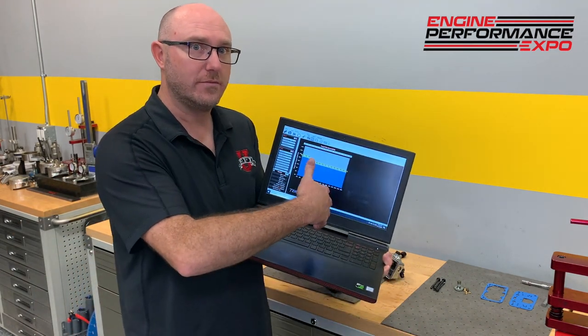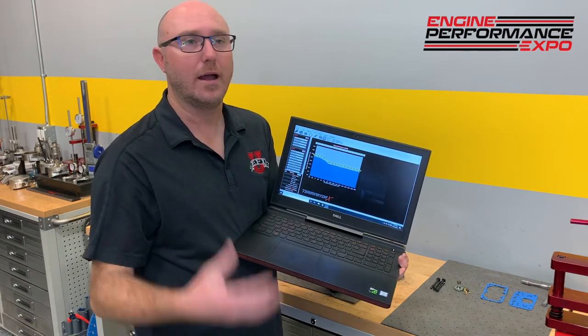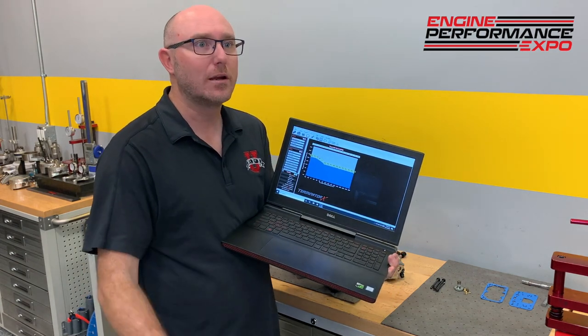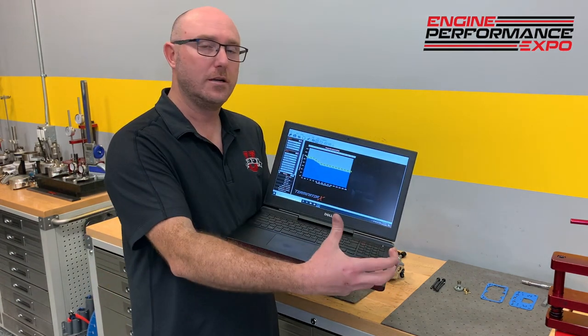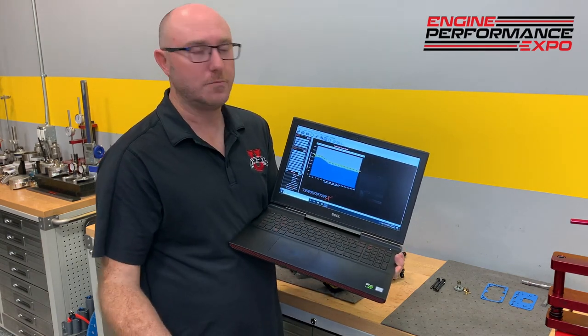One of the advantages of the Terminator X, I just say, at each temperature, I can pick the idle speed I want, and it automatically does that. What a great advantage. So you're not trying to get that thing working right and protect your hard-earned effort and money that you spent getting the engine right, worrying about the tune-up changing all the time.